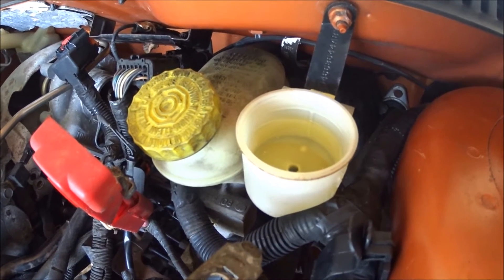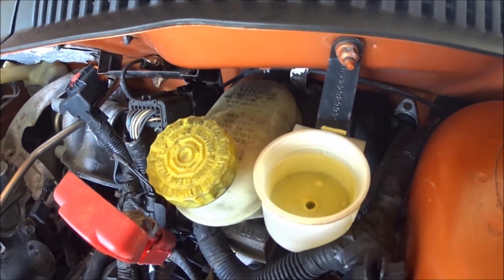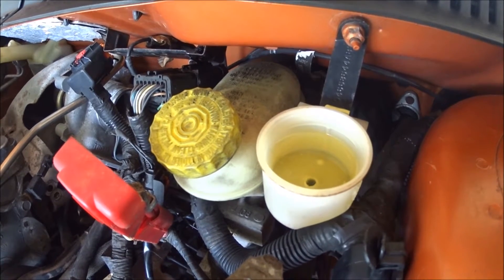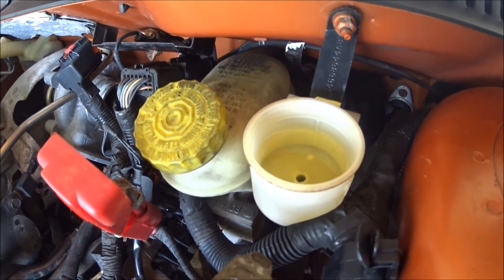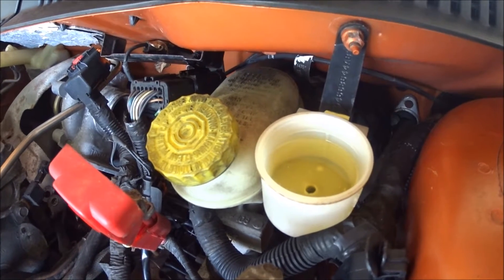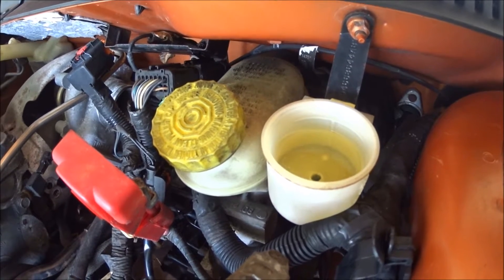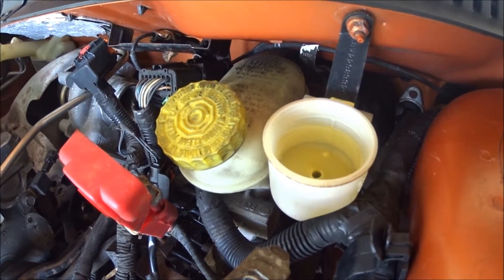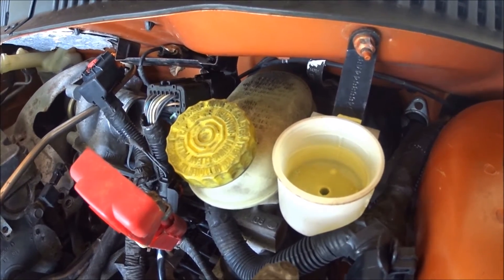What I'm going to do is stick my hand through the hole and push on the slave cylinder. See the bubbles coming? That's what happens. Do this slowly, release it out slowly. You can see the fluid level drop a little bit. I still have my hand on the clutch fork — I'm pushing it again. There — I'm holding it in hard, nothing's coming. I'm letting it out nice and slow. When you do this, you want to do it slow because you can break the air bubbles up into being really small and then they don't like to come out.